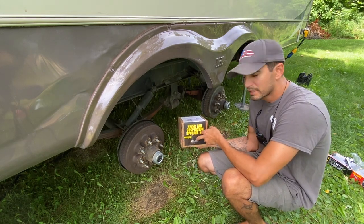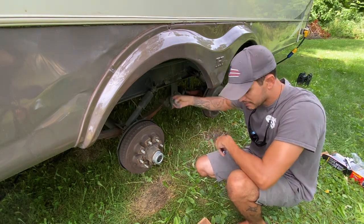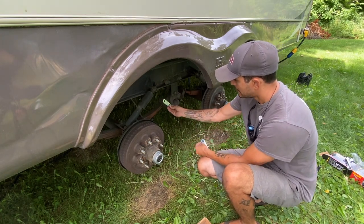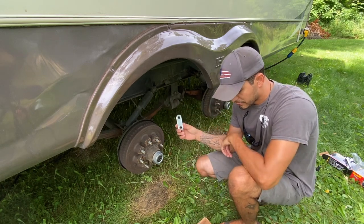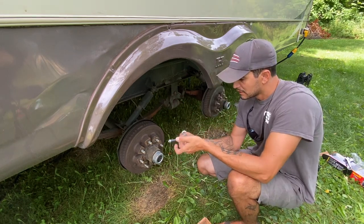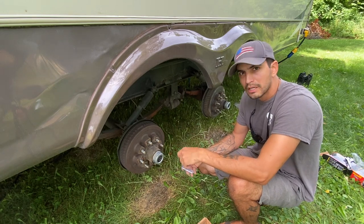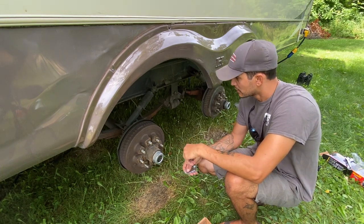It is by Lippert — I'm going to put a link in the description below. You can see just by holding it up, this is the right size piece, and they sent the larger ones which would make the suspension be all out of whack. So make sure you have the right size shackle for the right size equipment. It came with new little plastic bushings for the inside. I didn't want to do the wet bolt kit because I don't want to worry about greasing them, and I think these are fine as is — we'll see how they do going down the road and give you a report back in about a year.